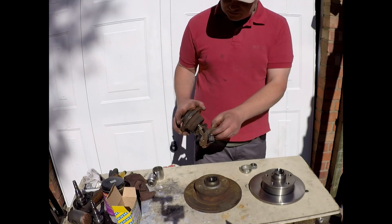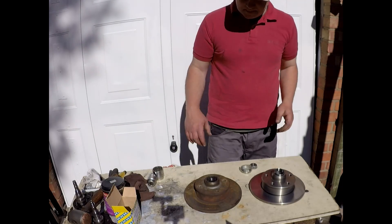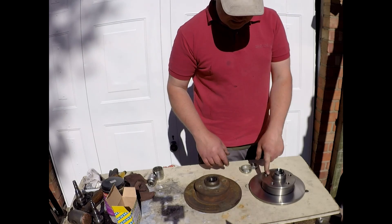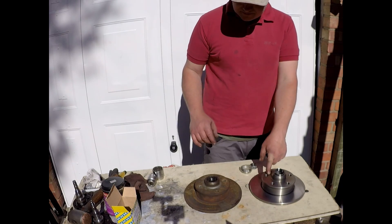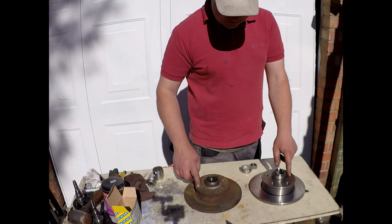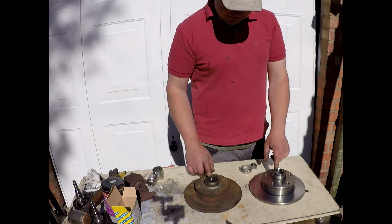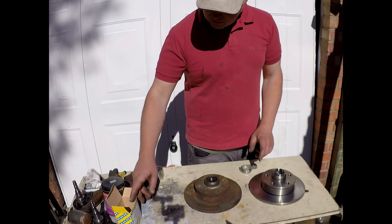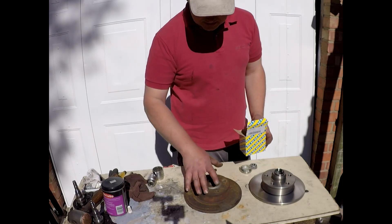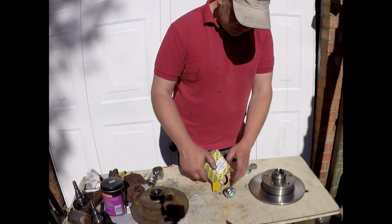So I'm going to disregard the Mark 4 setup because I know I'm not going to use that. The only difference between these two discs — this being a five-stud Golf/Corrado item — is the number of holes where it's been drilled. These are fairly cheap. What you can do is actually transfer your wheel bearings out from the old disc. A box of wheel bearings is around ten pounds, so that's not major. The main thing is to get them set up properly.